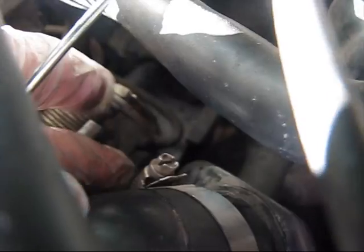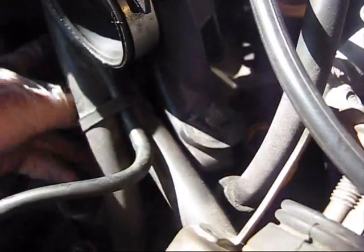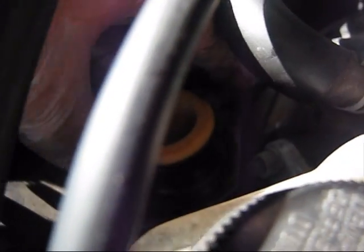That's why, using a very small tiny screwdriver, access this bolt, loosen it, and first disconnect this bottom part by removing this bolt and squeezing it out. It's out of the way. Firstly I disconnected this bottom part. You need to remove this, which is attaching there, and then with both fingers you have to squeeze it down, but before that lubricate this piece with WD-40, so it will be easier for you to remove.